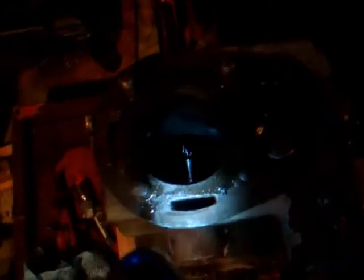If I can spend the rest of the evening just checking the piston and running a few more checks on the connecting rod to try and establish if that's straight. But I think cylinder honing is going to be the way forward. I think that's how we're going to get this piston to slide in there easily. Fingers crossed then that the connecting rod is straight. Let's hope.